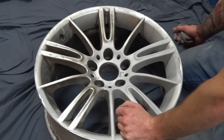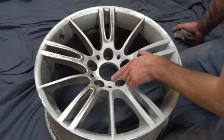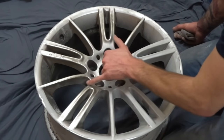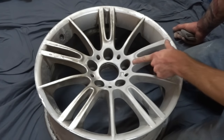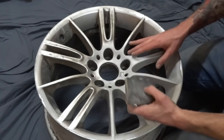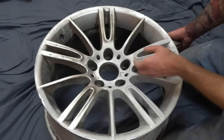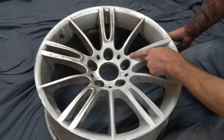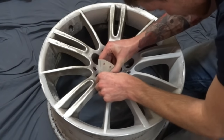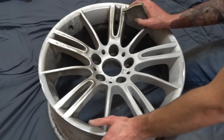One thing I should mention is that it is very important, especially on the flat faces, to get every little nook and cranny from being shiny. So if you see over this side, you've got shininess here, and how I've worked it down to a dull matte — that's because I've got a nice surface now, it's all been rubbed down, it's all even. There's no dirt, or there will be at least no dirt once I've got it all degreased. It will be a nice flat surface for the primer to adhere to. I need to make sure that every single shiny area is covered. So I'm going to spend a little bit of time just getting this finished up.